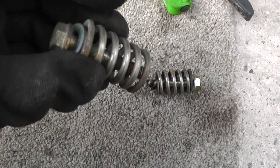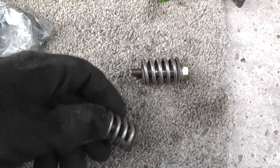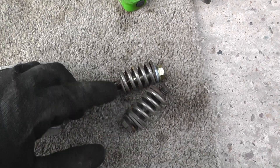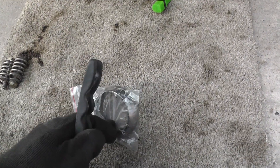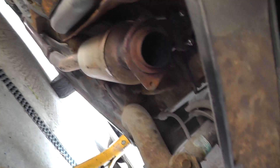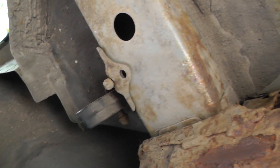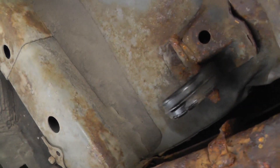I've got the same old springs, but this time I'm going to use these regular bolts rather than those spring bolts which are meant for the job, because basically they end up snapping. These are brand new bolts and I'm going to copper slip them with the aim that possibly they won't snap next time — though you never quite know. Then I'm going to go underneath and wire brush any remaining debris or rust from where the exhaust joins up, just so this new gasket will go on there nicely. It's not too bad but I may as well get rid of any big bits of rust. I'll also put a bit more WD-40 on these bushes so it slips in nicely, and then copper slip the bolts.